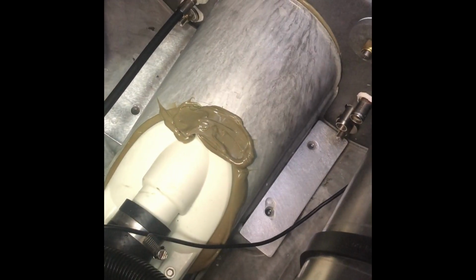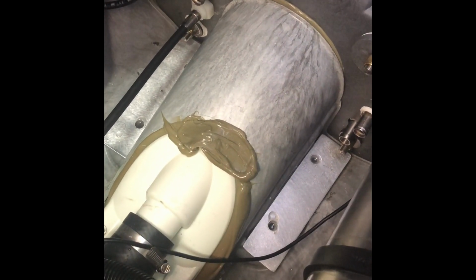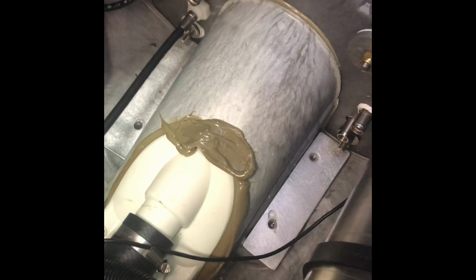As you can see, it's starting to come out the rear hole. If you have any residual epoxy that's spilled over, you want to clean that up right away, because the original factory bosses need to sit flat on top of those plates.